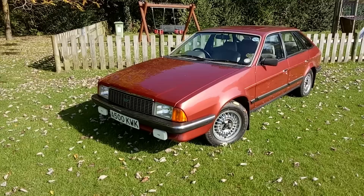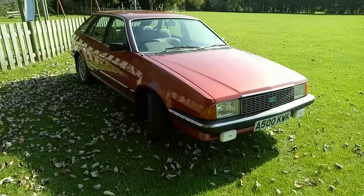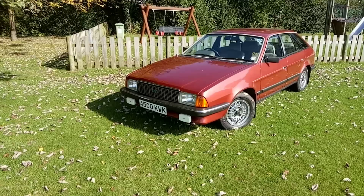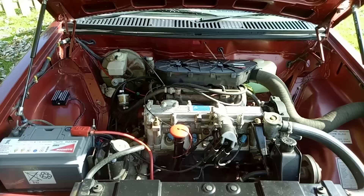So oddly the windscreen wipers are now visible — that's progress apparently, because there's no huge tall engine to accommodate. It gives the car a fresher look; it certainly looks very 1980s. The only engine options were the 1.7 or 2-litre O-series. On top-spec models the 2-litre comes with twin carburettors putting out about 104 brake horsepower — not far off the power of the 2200 six-cylinder, though obviously it doesn't make quite the same noises.